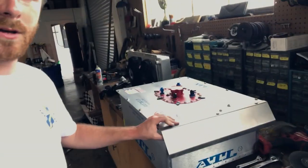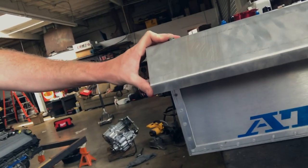I've got a rough outline piece of what I'm working on here. I've got the three holes on the top drilled so that it can actually mount to the fuel cell, and then on this lower plane is what we'll actually affix to the frame rail itself. Now it's worth noting — this isn't what's going to actually support the fuel cell. This is partially aesthetic, partially stability. It will do a lot to position it and hold it in place, but it's not going to support the weight. I will add a couple of heavy duty straps over the top and tubing underneath it for the actual support. But this is the important part for deciding exactly where it's going to go, getting it positioned, and making it look good.